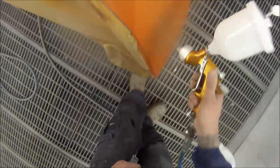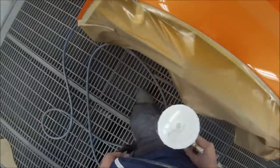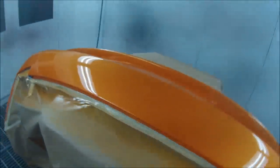That just about brings it to an end. I'm just going around making sure there are no spots that are a touch too dry, going over it all again. I gave it a good five minutes, then clean out all your guns once you've finished painting. You don't want to hit the bake button too soon or else you can start getting runs, or what we call solvent boil — where air or solvents get trapped inside the paint once you bake it too quickly. Nice and clean, got a good finish on it. I'm pretty happy with how that gun performs — you can get a pretty killer finish with it.